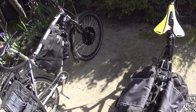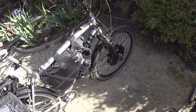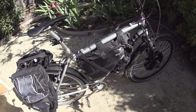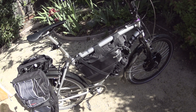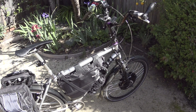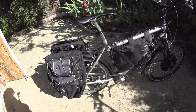To me the hub motors work fine. This particular one is a 1000-watt motor — this thing has tons of power. I've shown you the video where I can haul 285 pounds — myself and all the groceries — with this bike, no trouble at all. 21 amp-hour battery. I showed you the real-life results where a 32-mile trip pulling that trailer loaded with groceries, myself again roughly 265 pounds, 32 miles on that trip and I used barely half that battery pack — 21 amp-hour battery, 48-volt system. If you're serious about power and range, 48-volt is, from my experience, the best way to go.